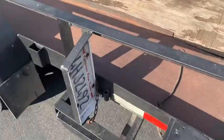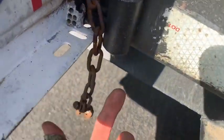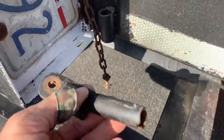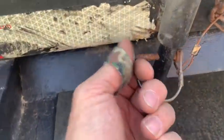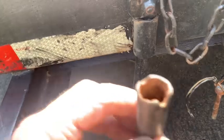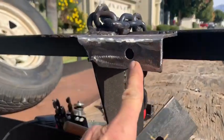To hold out the ramps, they have a pin that goes in here and it's supposed to come down in this area to keep the rail from sliding out. This is busted off — it's actually half-inch EMT, never should have been there. On the other side, I've got a piece of quarter-inch, six by quarter-inch pipe nipple; they drilled a hole in it and welded it on. When that drops in, it keeps the ramp from sliding out. So I'm going to get a pipe nipple and add it to this thing.